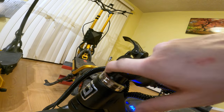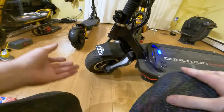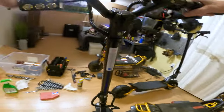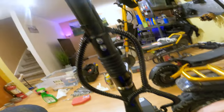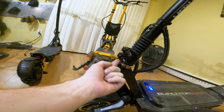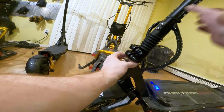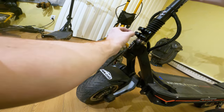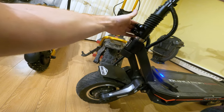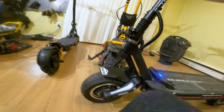So I'm gonna try and put some actual grease on here and see what that does. I did it — check this out. We saw a little bit of clicking coming from the rear suspension; I can adjust that later. But the front bezel piece — no more squeaking. I'm wiggling it back and forth. What I had to do was clean that front bezel piece really well, then squirt grease down the top piece here, and the grease ran down the front of the collar so it's not rubbing anymore. There were two spots that were very clearly worn down from rubbing. I tightened the clamps as tight as I possibly could using tools, covered the whole thing in grease, and now the noise is gone.